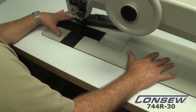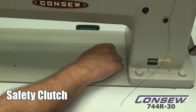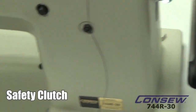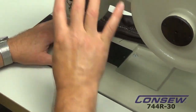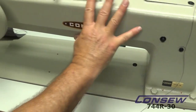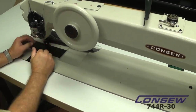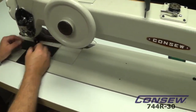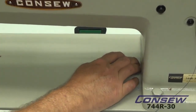We have a safety clutch that's built in. The safety clutch release button is here and the safety clutch is on the back. If for whatever reason you break the needle and jam up the hook, it's going to save those parts by disengaging the lower portion of the machine from the top portion — the top portion will continue to move, the bottom portion doesn't. You clean out the thread or broken needle, then reset it with the reset button on the bed.